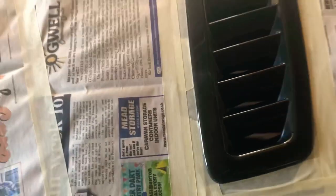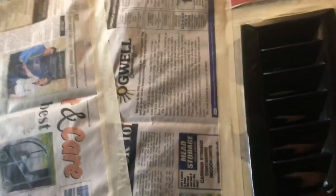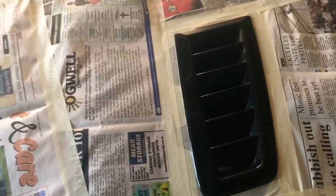So I'm going to try and nip this one in the bud by giving it a fresh coat of paint - that's going to be part one of the little maintenance side of this car. I'm going to start off with some 800 grit paper and go over it, scratch it back, then use a high build primer followed by gloss black and some clear coat. I always like to do little tasks in between coats, so not only am I doing the vents today but I've also got some blue mirror covers to take to gloss black as well.